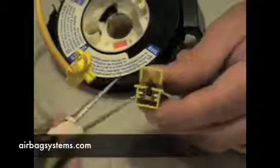This actually helps you when you're testing the clock spring, so you're not laying down on the floorboard under the dash trying to test for continuity like you would think. Just unplug the steering wheel clock spring down below and let this help you — it will keep it shorted together. All you're going to do is test the top part.